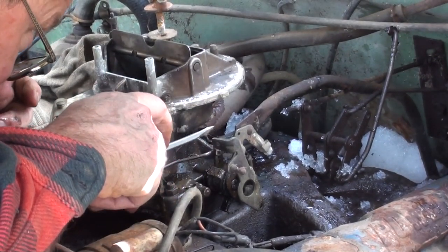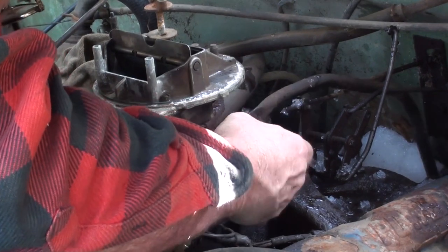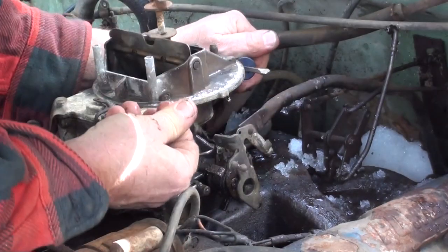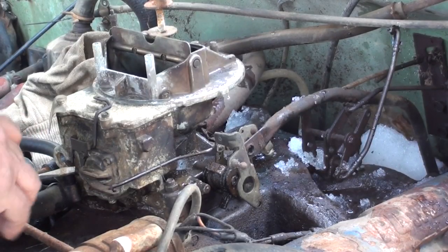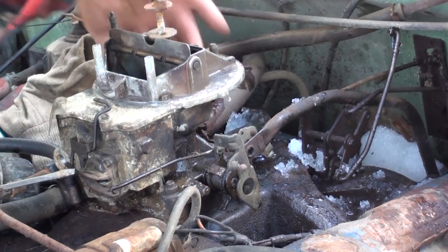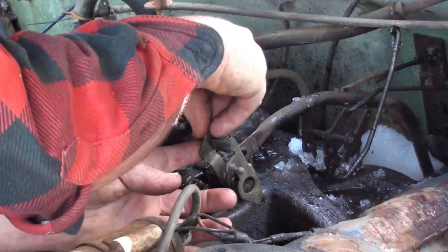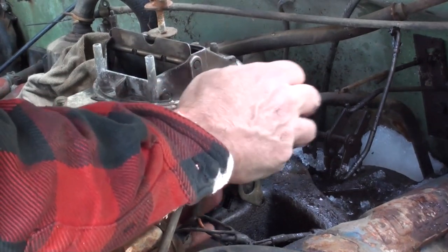This has a nearly impossible to acquire clip, but not quite as nearly impossible as what was thought. There are no other vacuum lines connecting this because the PCV line is connected to the base plate. It's an E-clip, by the way. Seven-sixteenths on a long extension — not much effort required there.